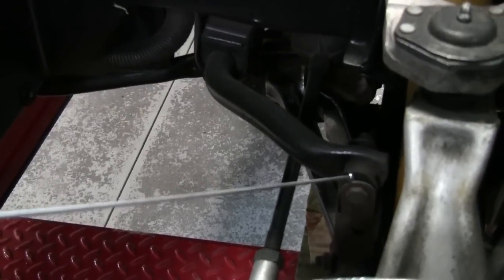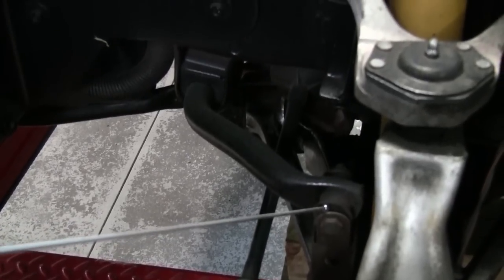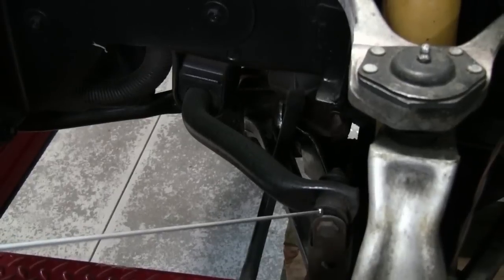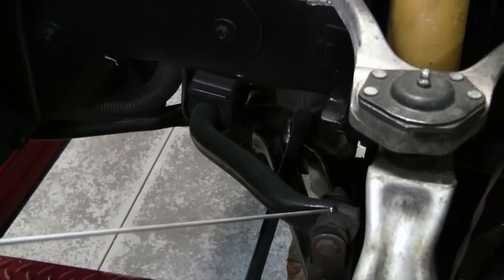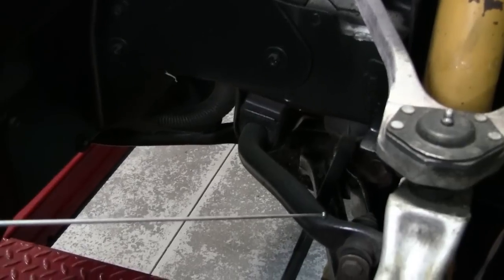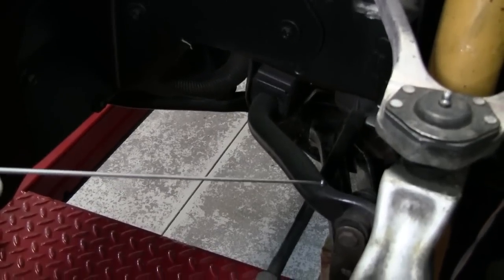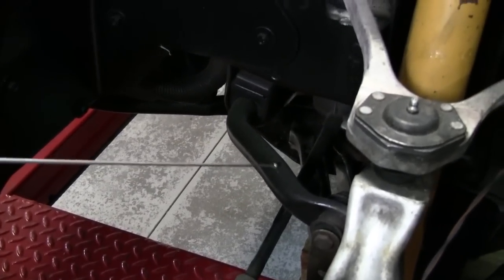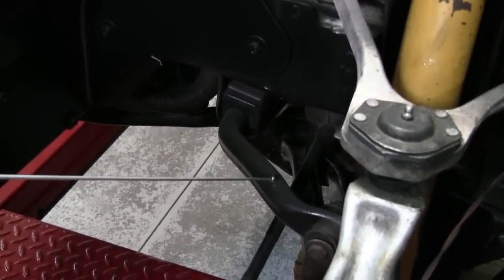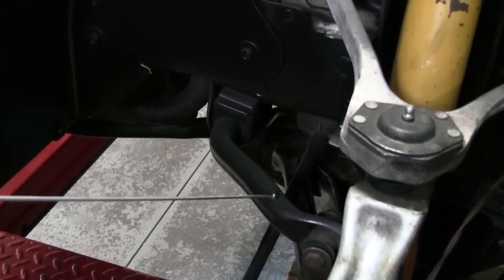These are different indicators — you've got some tapping and groaning, and you're seeing the car rock right to left. You want to take a look at these and see what kind of condition they are. You'll notice that this bar is a larger diameter than the rear bar, and that's because you've got quite a bit more weight up front, and that's when stability becomes an issue. We're going to give you a little text on exactly why you might want to upgrade to the larger bar.